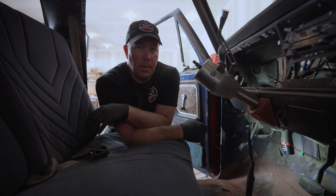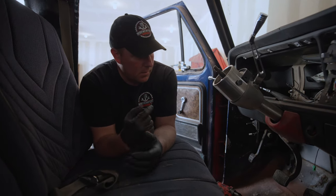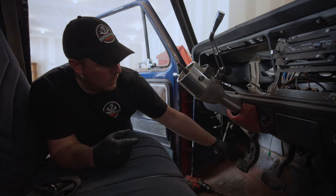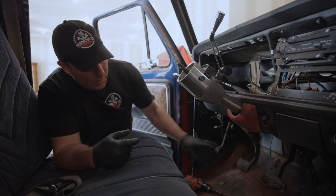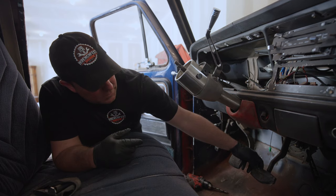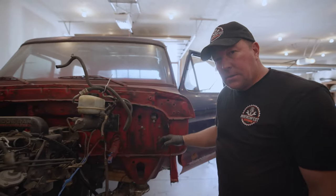We're drilling a different hole to see how this fits against the part brake and go from there. We got all the pedals hung — we got the clutch as close as we could to the driver's side, but it's still way too close to the brake pedal. So what we're going to do is heat the clutch pedal and bend it — make it go where we want. I'll probably have to shorten it up because after I bend it it's going to lengthen, so I'll cut and re-weld the pedal. The brake's working out pretty good — just need to finish the linkage. Next thing we need to do is make a hole right in here for the slave cylinder.